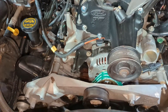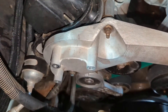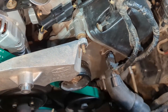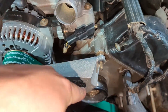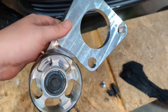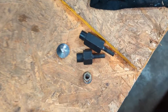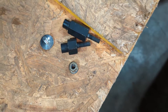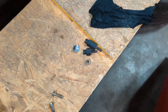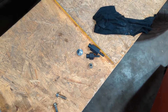The supercharger's on, but I had to get this pulley bridge on before I get it all covered up. Basically you got a nut there, a bolt at the bottom, and over here there would normally be a nut, and then there's another one tucked underneath. I have an LFP idler bracket and then obviously the idler. It takes these two little studs right here — you got to run those in basically where those nuts would be, and that extends things out a little further. I got this janky little bolt that holds the top one. I don't really like that, but it's just what I have for now, so I'll maybe change it up a little later.